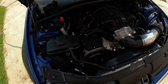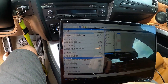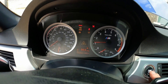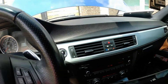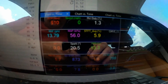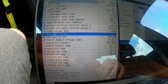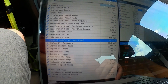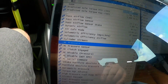As far as the AC control, I'm going to show you how that works in HP Tuners. Fire up the car — no lights on the dash, tach and coolant temperature working. Turn the AC off and get connected to our scanner. We're all connected and reading now. The first thing we'll show you is our generator status — it reads 'pass' and we are charging. The CAN box sends the correct signal to the ECU to control the PWM Gen 5 alternator.